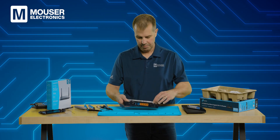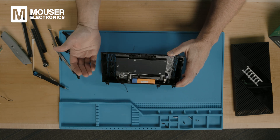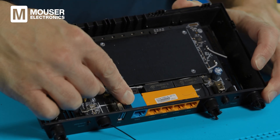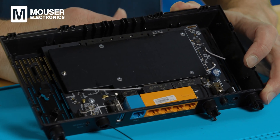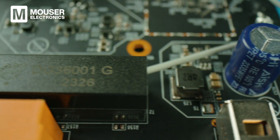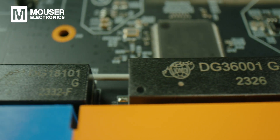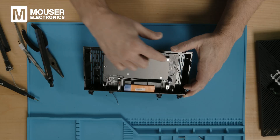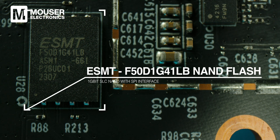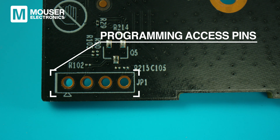Let's start looking at what's inside this PCB. Working from the back, the configuration is almost identical to the Wi-Fi 5 router — a single connector for the WAN housing and another for all four LAN ports. Behind these ports are the Ethernet transformers for ESD protection, circuit isolation, and signal transmission: two two-port transformers for the LAN and one one-port for the WAN. Up in this corner of the PCB is a one-gigabit NAND flash memory from ESMT. There also appears to be a set of access pins likely used for programming during production manufacturing.